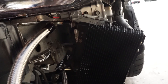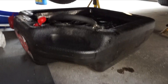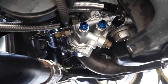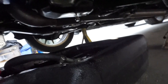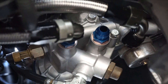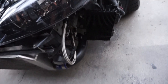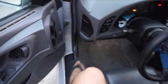After your lines are made, go ahead and drain your oil and install your fittings. Make sure you get new copper washers and once those are torqued down you can start placing your lines. I'll let the oil drain, take off the oil filter housing, hook up the lines, and catch you when that's done. Once everything is installed, go ahead and turn on the car to make sure you have no oil leaks.